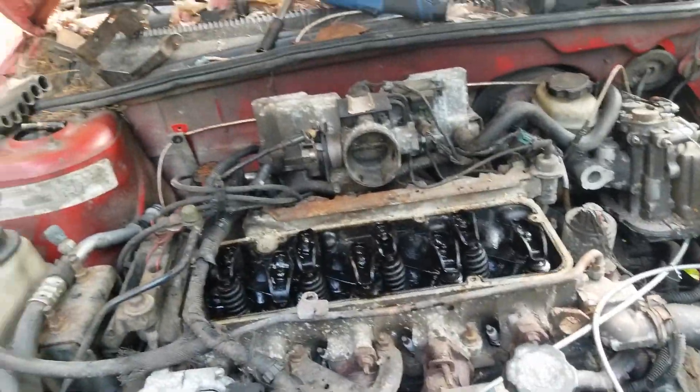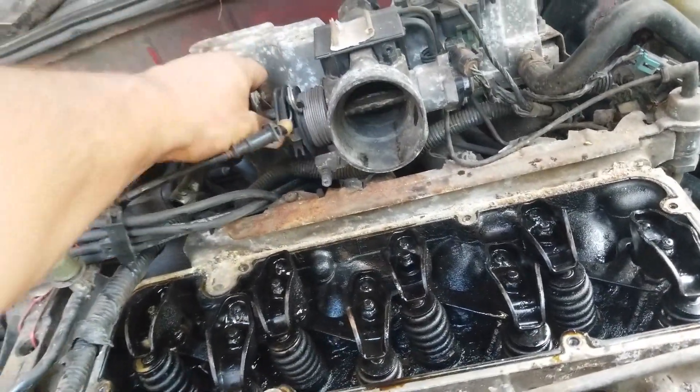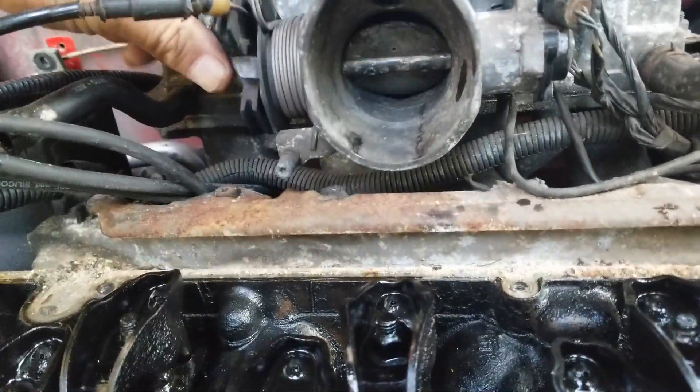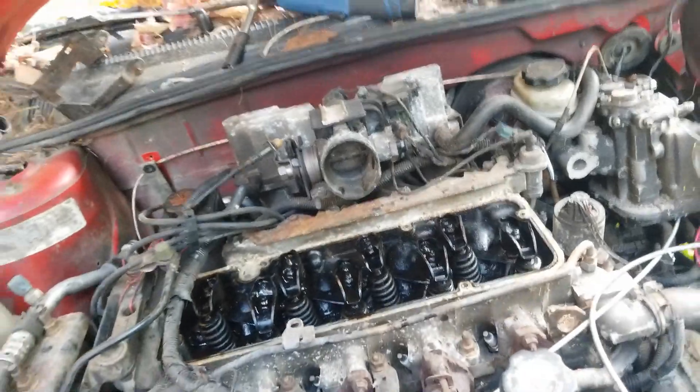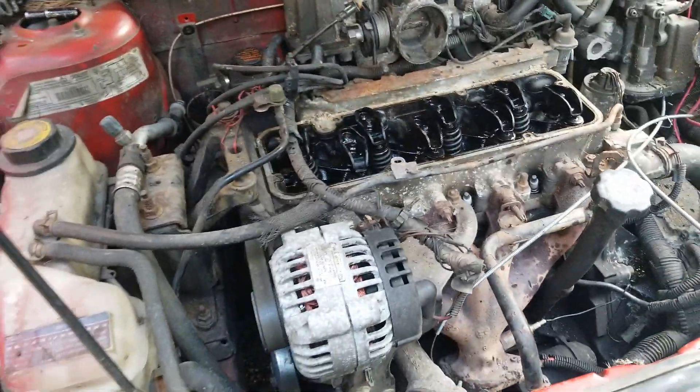There is a possibility that there may be some stuff on the valve that might be holding it open a little. The engine was running okay, but after I shut it off and came back out a while later, it felt sticky. It may have just been my imagination because I don't even see anything in there that would have stuck it. I think this engine is just fine. That means our gasifier was not making tar - it was making a lot of soot, though. We know we need more filtration and we need to make sure we get our gasifier hot before bringing the gas up to the engine. I need to have my blowers before the filter so they're not clogging my filters up quickly.